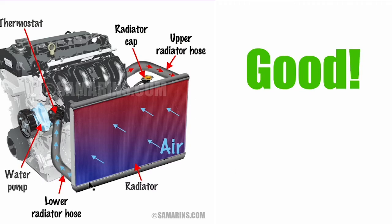So here's our system: we've got hot water coming into the top of our radiator, it passes through the heat exchanger as air flows over it, it cools the water down — there's our supply of cold water. Then the water pump is siphoning it up, pushing it through the engine cooling cylinder one, cylinder two, cylinder three, flowing into the block, going up to the head, cooling all the valves, cooling everything down, coming out the back and going back into the radiator. That's exactly what we want.